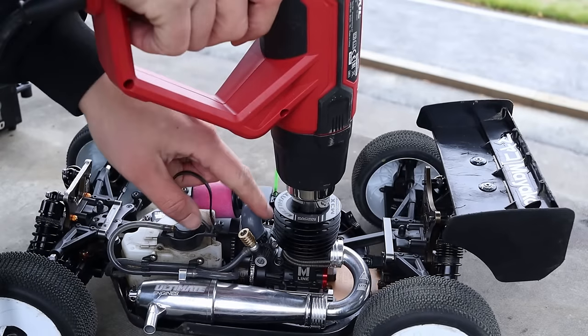Another thing is that the fuel we use, if we have castor oil in the fuel, the castor oil will actually build up a surface on the piston. There's a process that happens where the castor oil reacts with the metal in the piston. So that needs to happen. So there are all these kinds of things that only occur when you actually run the engine and there is an actual combustion event with the actual fuel we run.